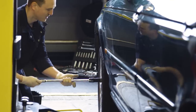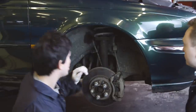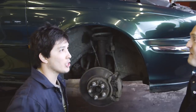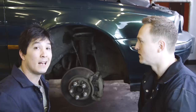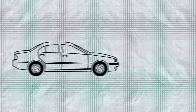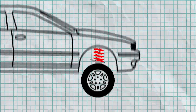Let's get to work jacking this Jag suspension up. We've got the wheels off and what we're gonna do next is pull out this whole assembly and see what diameter the top mount is, because our great vision is to fit a big piece of billet up in here to push down the whole suspension so we get more ride height. Less articulation, but more ride height — but it'll be fine because we're going to take the anti-roll bar off as well. The plan to raise the front: remove the spring and shock absorber units on each side, fabricate and weld in spacers, then put everything back together.